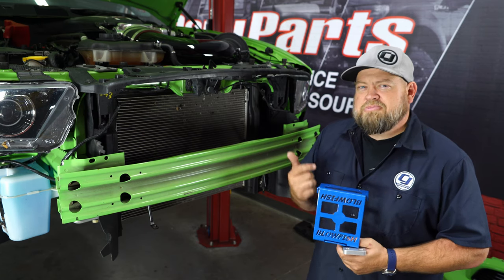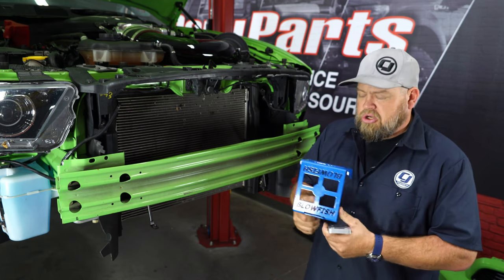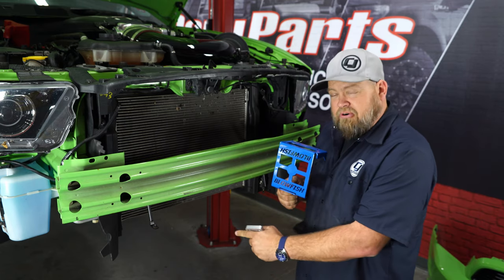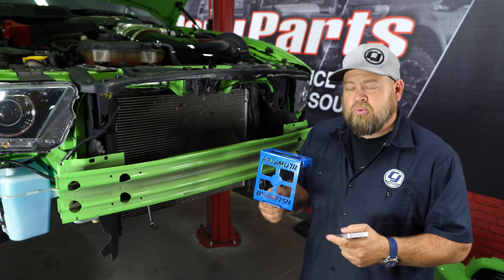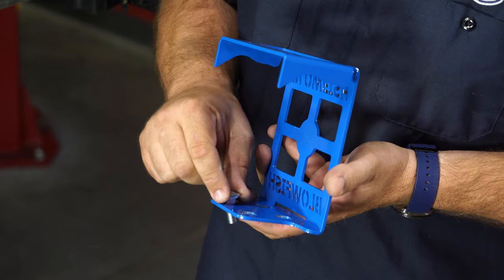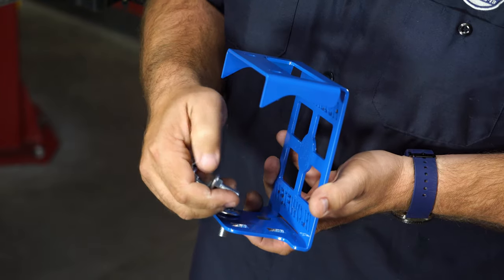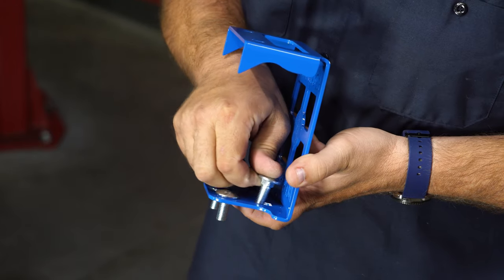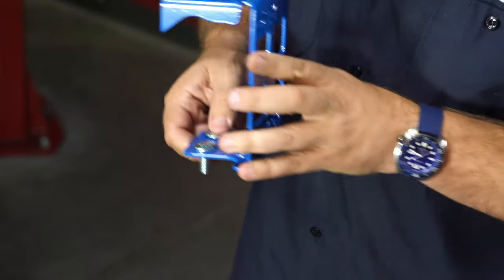We're ready to install the main bracket. At this point you have to decide where you want the tow hook to come out. If you want the standard height, you can install this with the shorter carriage bolts. If you want to hang it down a little bit further — say you have a front license plate, intercooler, or on a 2010-2012 Mustang for more room with the grille — use the provided spacer and the longer bolts. In our case, we're using the shorter bolts since we have no lower grille on this car. We have the high flow Roush on there so it's wide open. The bolts should go through smoothly; if not, just take a little of the powder coating off.